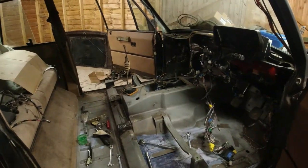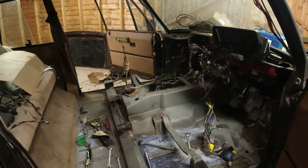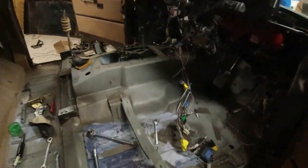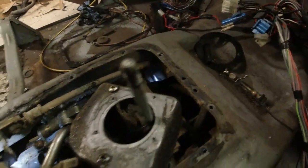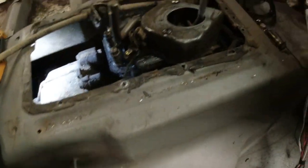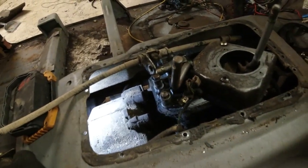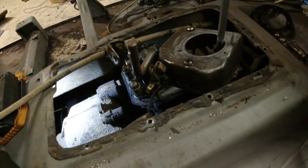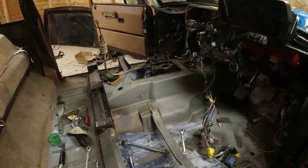Mr Hammond has promised me one of these gearboxes in exchange for me building up a set of carburettors for him. It's come from a relatively low-mileage car as well, so I'm quite pleased about that because it might end up in Project Bob. The only thing I need to work out is how I'm going to do the long stick — it's going to need an extension on top of the gearbox so that'll need an extension in order to push it all forwards, because that's the transfer lever, and that's the gear lever. Gear lever is level with the front of the seats but we want it up here, at the base of the heater. So I'll research what the Defenders use on this LT77 gearbox — there'll just be an adapter plate on top, I would imagine. I've also got transmission covers for it, so that might just work.